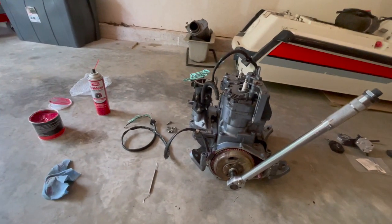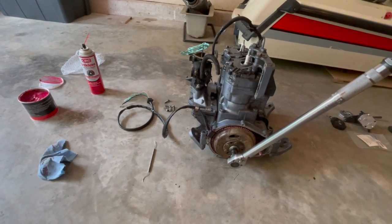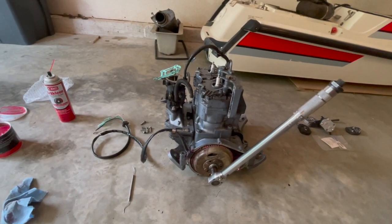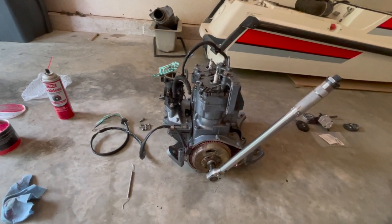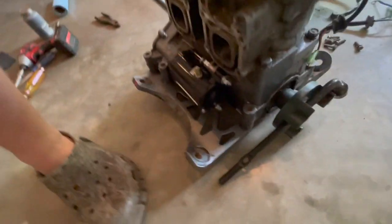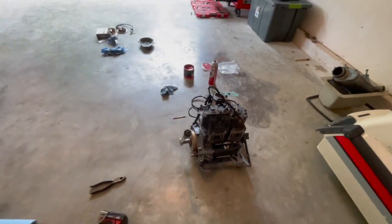All right, if you're a redneck and you're doing this on your garage floor like I am, then you're gonna need some special tools. So we got a torque wrench. The manual calls for 70 Newton meters. Anyways, it translates to 51 foot-pounds of torque. And I just jammed something redneck in there too to keep it from spinning over, and put the plugs in to make it even a little bit more difficult. So, good stuff. She's all torqued down.